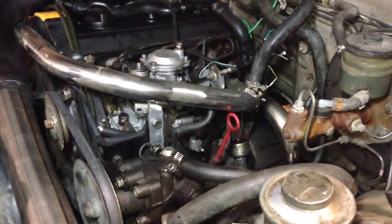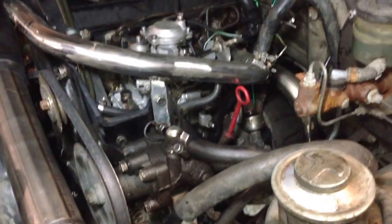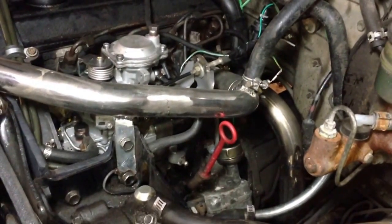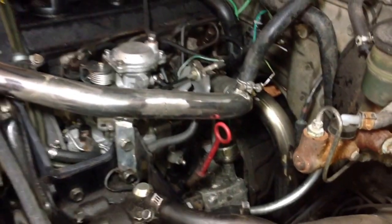And very soon we should also have a kit for those of you who would like to go automatic. We have done a couple automatics, but what we've done is gone to the two-wheel drive manual valve body transmission and bought an adapter and hooked the transfer case from an early four-wheel drive standard onto it.